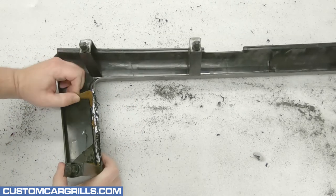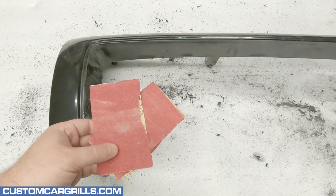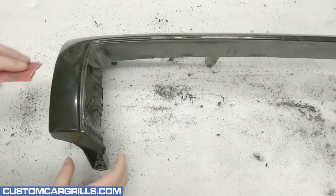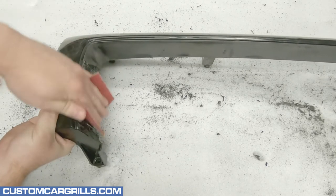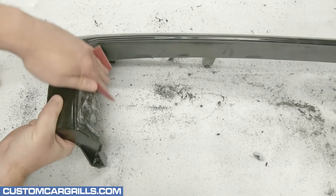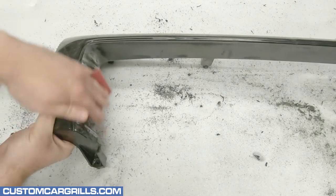The tape that was on the back of the reinforcement mesh can be removed and discarded at this point. I'm going back to the coarse grit sandpaper to get the PlyoGrip smoothed out. The plastic repair material sands pretty close to what ABS plastic does. It's not too difficult but attention to detail is key here. If some of the areas are over sanded, that can be corrected by adding more PlyoGrip or fixed later in the next step.